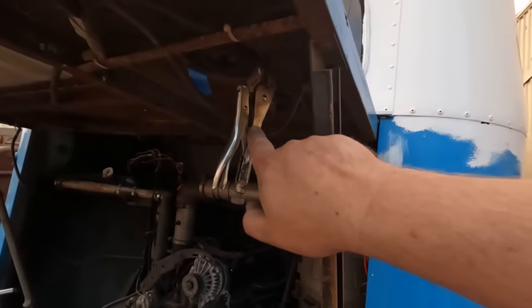I have fixed dozens of little flaws on the side of this bus, and as I did it I discovered there's hundreds more. As I was trying to come up with a good excuse to not actually fix all the body flaws, I thought of something. A few months ago I bought myself this Durabac 18 — it's not a paint, it's more of a rubbery bedliner-like coating that can be applied with a roller and easily touched up. This stuff says it covers up imperfections. In order to get a good idea of what it can cover up, I need to leave flaws — otherwise we won't learn anything. We've got some pitting here, more pitting, lots more pitting. This area has a lot of cracks in old bondo. There's some little pinholes. We'll look at them after we coat it and see how visible they are.